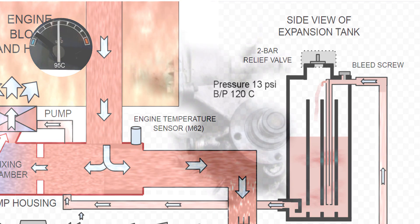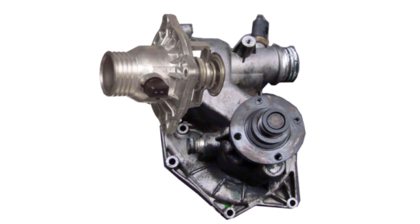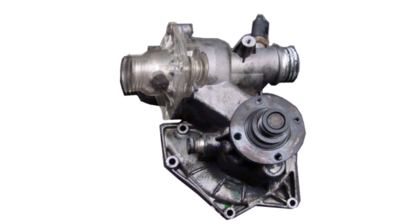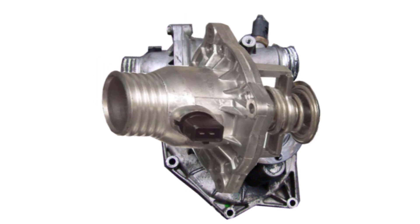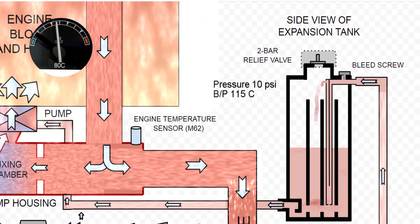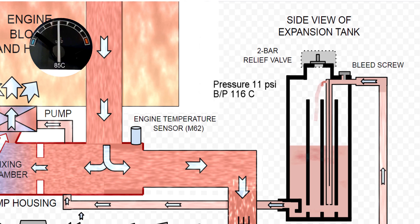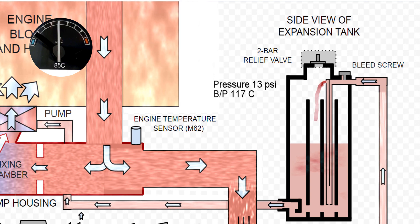For the E38 and E39 with the awful temperature-mapped thermostat, the baseline is 108 degrees C at the input to the engine — not the output, which is probably about 10 to 15 degrees higher depending on how hard you're pushing the car. So you can imagine that without any pressure the coolant is going to boil. That's its primary function: it provides a pressure vessel which coolant expands into and increases the boiling point of the coolant. Without it, your coolant is just going to boil.